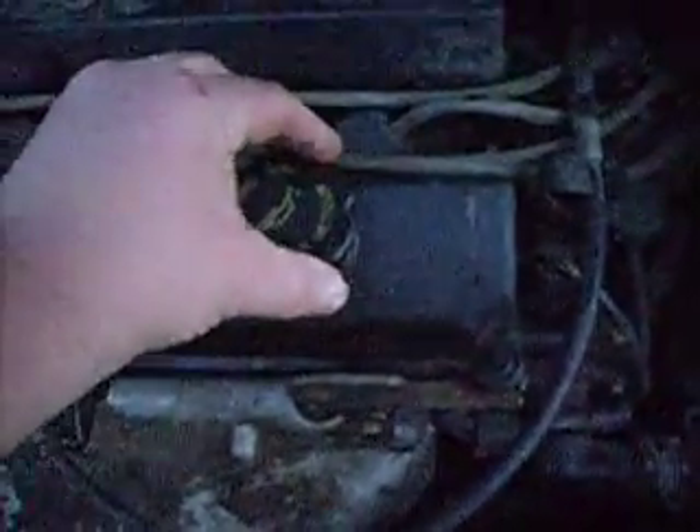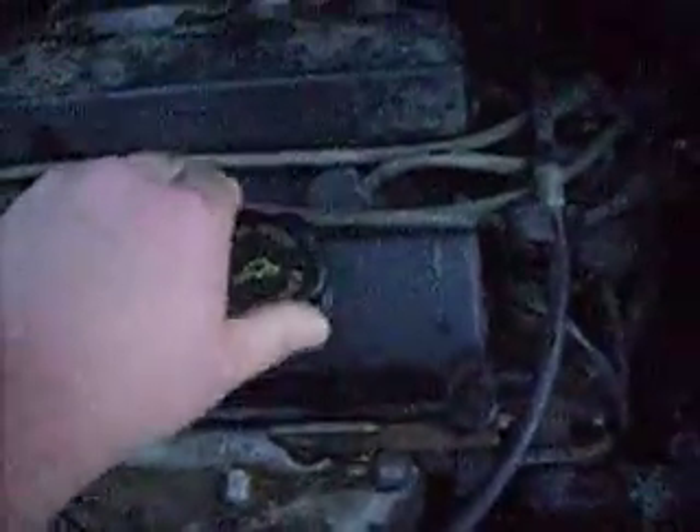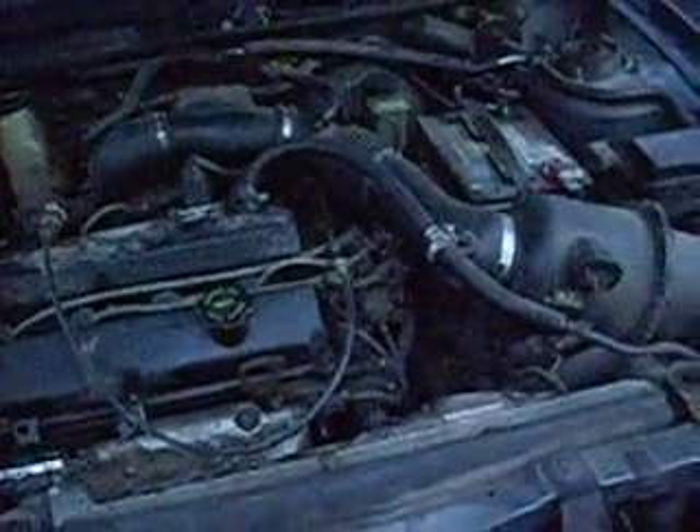That tap gets louder if you're sitting with the thing in gear. It's getting kind of dark — I don't think it's going to show anything coming out of that cam sensor opening — but let's pull this valve cover oil filler cap. Look at that. I could put my hand over it and just feel the pressure coming out of there — you can hear it too, hissing as I put the cap back on. It's trying to fight the cap. This is actually worse than this after we did the compression test. A very pronounced miss, a lot of blow-by.